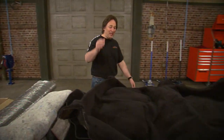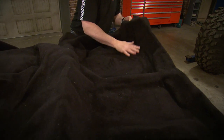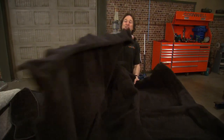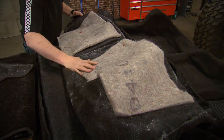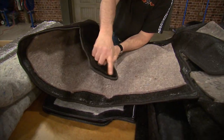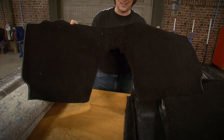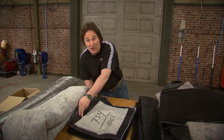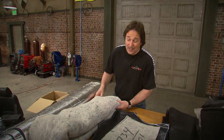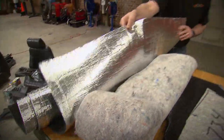For the new interior, we went to a place called Stock Interiors and got the whole setup for a Mazda Miata. This is a form-fitted carpet with your footwells and your cross members, and there's the toe board, so this thing should drop right into place and just fit great. Notice that the jute padding is already glued right to the carpet, so you don't have to chase that around. For the rear shelf we also got that panel with the padding in place and nice finished edges. The final piece is this vertical panel that goes behind the seats. Any time you're doing a custom carpet installation, you might want to pick up some extra material and padding, because if you're putting something in that's going to create more heat — like a V8 — this padding also acts as a heat shield.